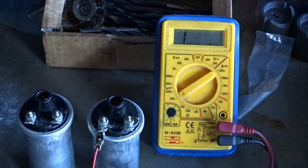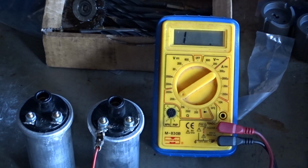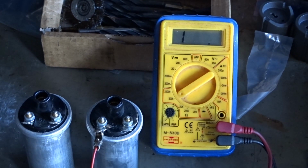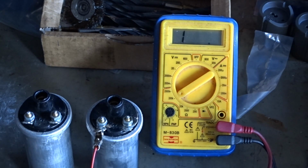And I was thinking about it the other night. I go, if you change all the different carb settings and you're still getting the same problem, it can't be the carbs, can it? Because if you're changing that many settings, you should never get the same problem. It should change straight away as soon as you make one change. So what he did, he checked his coils, and one of his coils was breaking down. Which kind of makes sense, really, because if one of your coils is breaking down you're getting a weak spark, and when you wind that throttle open you're pumping fuel into your cylinders, and with that much fuel going in, for that instant it's flooding the plugs and stopping it sparking. So that'll give you that dead spot. That's what I figured anyway.